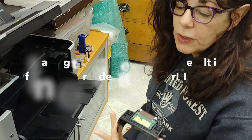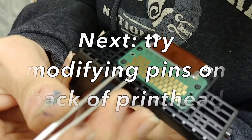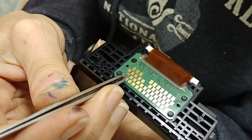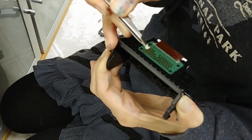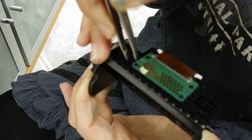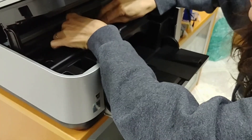Okay, so putting it together — that didn't work. Based on things I've read online, these are the connectors to the electronics of the machine, and someone else put out a video about this top row which has 13 connections. You can block a certain number of connectors, which presumably prevents the B200 error from being read if it's being read incorrectly. The first one recommended was pins 11 and 12. To block them, I cut a bunch of little squares of paper tape and simply place the tape over the pins — those are now blocked, so any electrical information they send to the machine will be null.